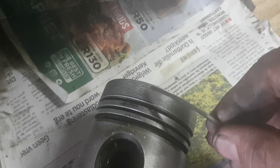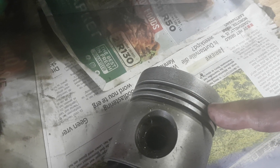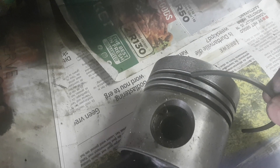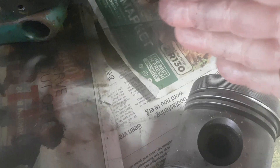When we took out the piston, the rings were sort of embedded into the grooves. After forcing it out, you have to be very careful not to damage the piston. Also, you don't want to push the ring sideways when cleaning. What you do is keep the ring close and use it to clean the piston head — push it down slightly like this so that you have guidance, and you guide yourself along like this.